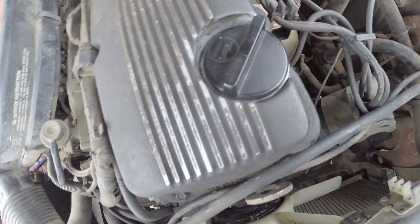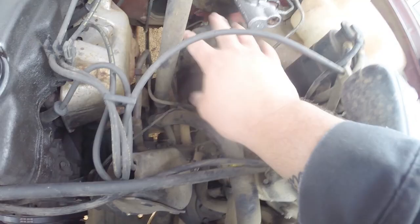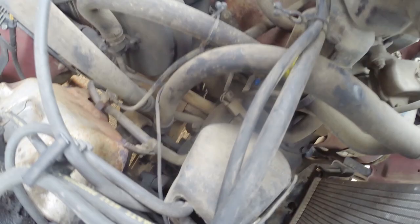All right. So what I'm going to do is I'm going to take the bolts off for this and take this hose off. Take this out. Take all this out. Now then, one thing: this line here is going to have to be plugged for the time being. I'm going to leave some of this hose, and probably put a bolt in it for now, and a clamp, and tighten it up. Otherwise, your exhaust is going to leak out. It's going to sound like you got a terrible exhaust leak, all right? So that's what we're going to do.